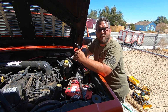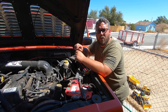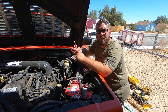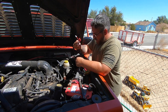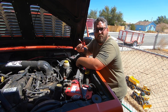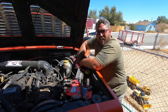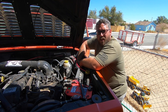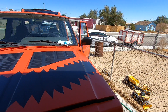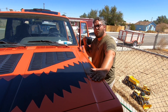The 275 model comes with a plug that goes into a cigarette lighter, but I'm not going to use that. I am going to use the wire because it comes with an inline fuse. I'm going to run a hot wire to the power distribution block — the bus bar I installed when I did my remote start. That bus bar runs off my auxiliary battery, so if the radio gets left on it won't run my starter battery dead.